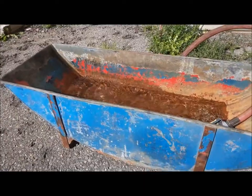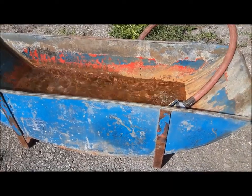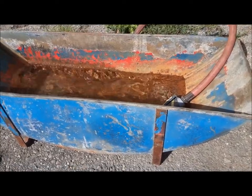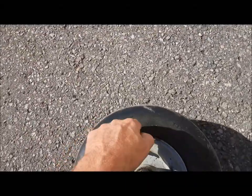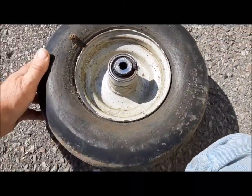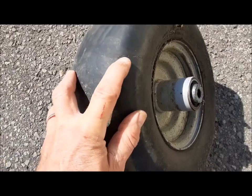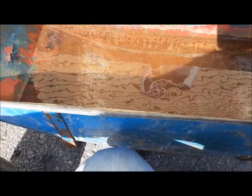This is a great thing to have — it's an actual purpose-made tool for checking tires for leaks, but you can pretty much make one yourself, even out of wood. So long as it'll hold the water for 10 minutes, you can check a tire for a leak. I've got this thing off and cleaned up a bit. It could be leaking around the valve stem, through the valve core, or around the bead when they get old. There could be a crack somewhere. Oh yeah — look at that slice right there. Look at that slice in this — it's hit something, could be leaking there. Anyway, we'll get it into water and find out. I'll put it down in first with the valve up, then flip it over and put it down with the valve down and we'll see what we got.